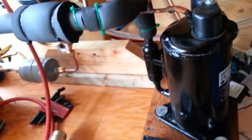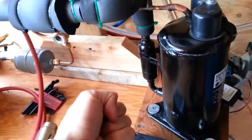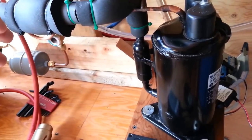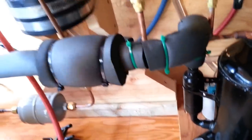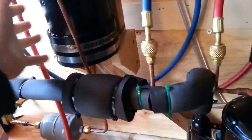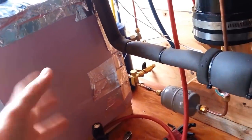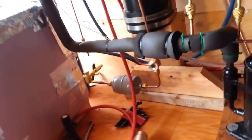As it's pulling that heat out, the temperature inside the box gradually lowers and lowers until we get to the nice point where we can pull our beer out and drink it. Coming back to the compressor, the whole process starts over again. Low-pressure vapor is squeezed — just like wringing out the sponge into the bucket. That squeezing action, whenever the temperature of the high-pressure vapor is higher than the water, squeezes that heat out into the water — it cools it down, forms liquid, goes back to the throttling valve, pressure drops, a portion of the liquid flashes back to vapor and the remainder boils away and absorbs heat out of the box. That's essentially a refrigerator.